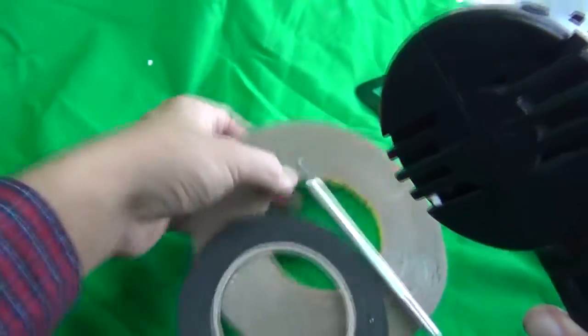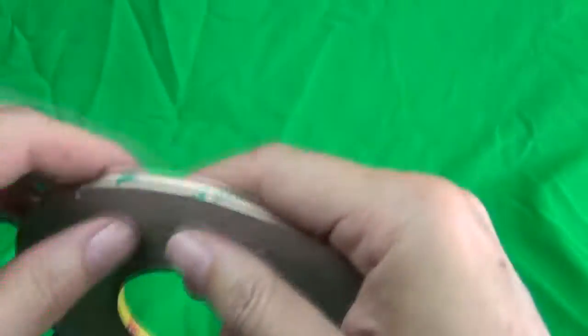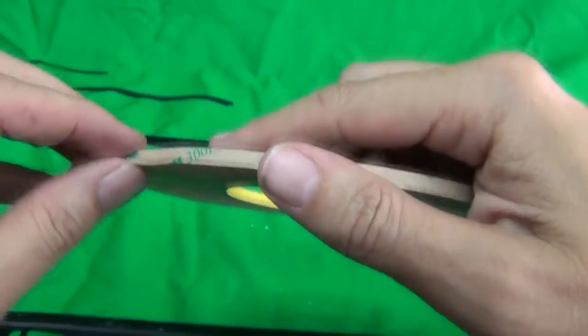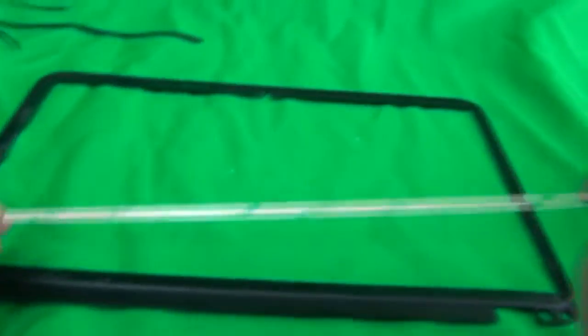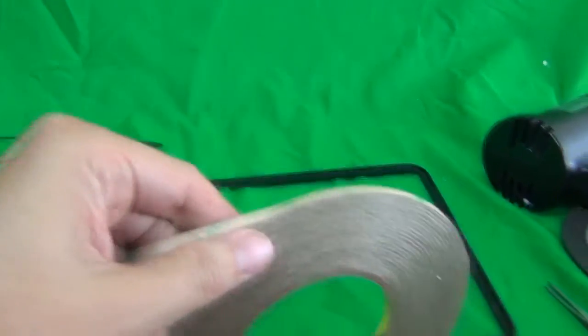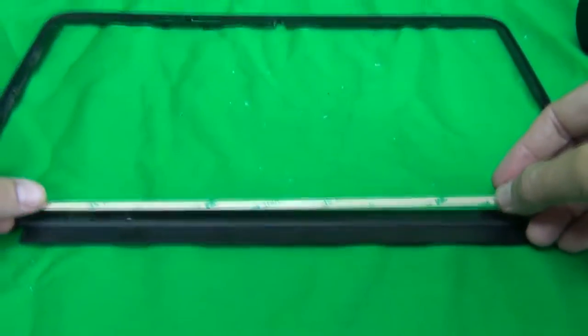Now, if this was not the case, if the adhesive came off, this product, this is a 3M double-sided adhesive tape. We'll have it online in our catalog in the fall. So you can use this product instead. What you do in this case is peel off a piece, use the scissors to cut that piece off. Put it down where you want it to stick. I'm not going to put it down in this case, but we would put it down like this. And then once you put it down, you use your hobby knife or X-Acto knife to lift up the other side, the paper side. I don't think I can do it here because it's not sticking to anything. But you use the hobby knife to lift up the paper side so it comes off, and then you have the same type of adhesive sticking on the bezel. But we're not going to do it in this case.